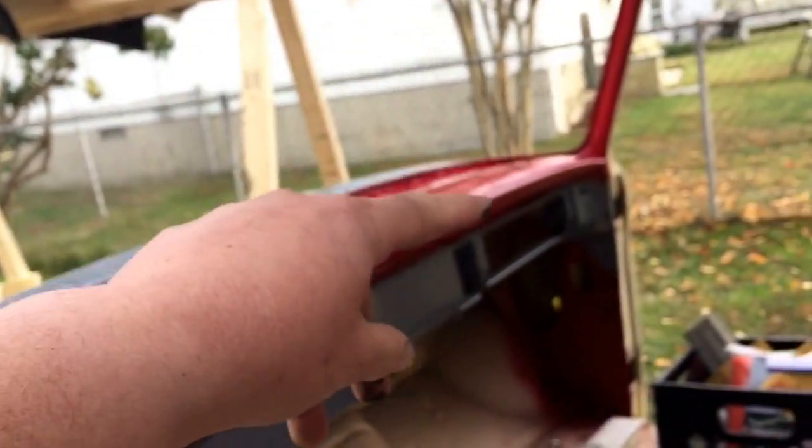I was sanding and got a little bored, so I started wet sanding the inner fenders that go right here. I've got those in black right now. I'm waiting for some of these runs to dry because they're still a little tacky - I don't want to start sanding on them and get them all nasty. While I was putting clear down, a hair off my head blew right into the paint job. I'm sure I could sand it out but what a pain. Some of this looks outstanding - super smooth - but I'm getting some orange peel, I think a lot to do with how I'm handling the paint gun.